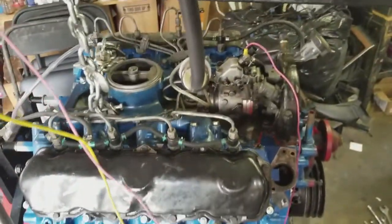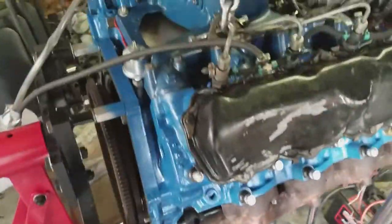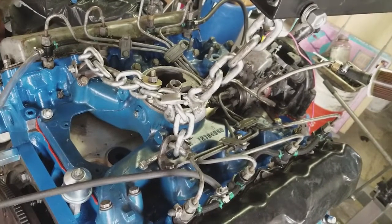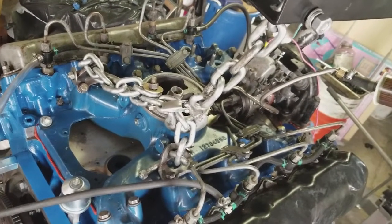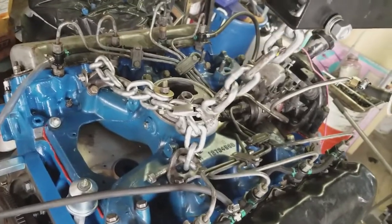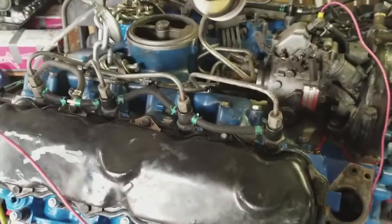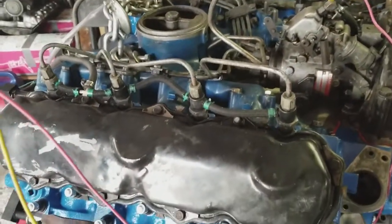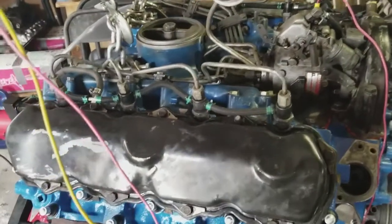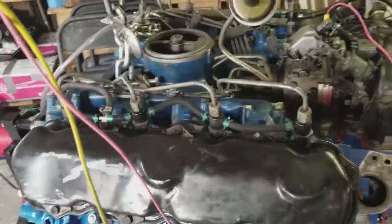First thing is, you don't want to actually run it on a stand like I'm doing — it's actually really wrong. I'm kind of hoping to hedge my bets here by hanging it from the shop crane. Maybe this will stop any sort of torsional movement. If you start up this engine and give it a lot of throttle, it could actually flip over. So you need a run stand to technically do it right, but I'm going to go like this. I've started engines like this before and it hasn't been a problem.